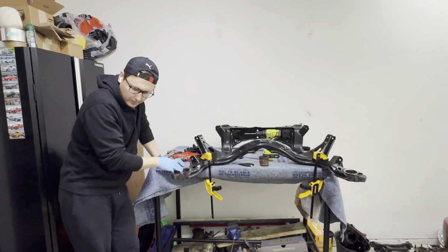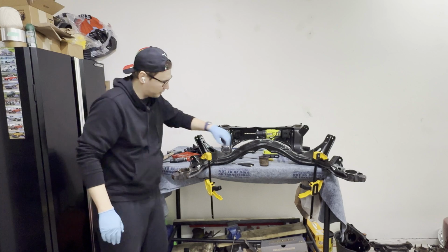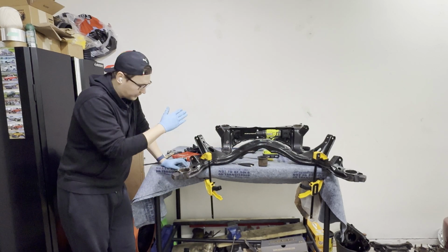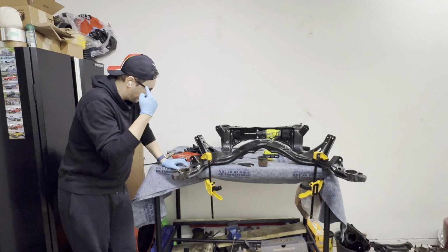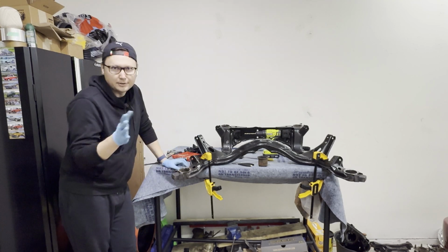I don't know what it is. Maybe the surface area was greater, or the tension that you put onto the metal sleeve is a little bit better, and therefore I was able to punch it out easier. So in the future, I will definitely keep that in mind and use a bimetal Sawzall blade to get these out if I do that again.